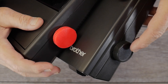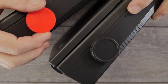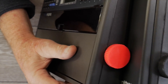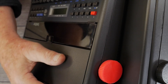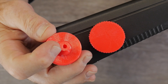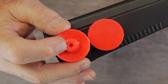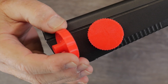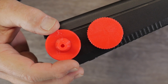It's a little bit more solid, actually — there's a little bit more plastic in it. And of course you get the option of printing whatever color you want. I opted on this initial one to use red because it kind of matches the red calculator button on the keyboard, which I think is a nice little highlight. We did print an initial version of the knob where the hole was just a little bit too big — we had to move the flat a little bit closer into the middle of the hole to make it tighter and shrink up the hole slightly. Also, in this initial one we didn't put any knurling on the rim, but the current design works fine.